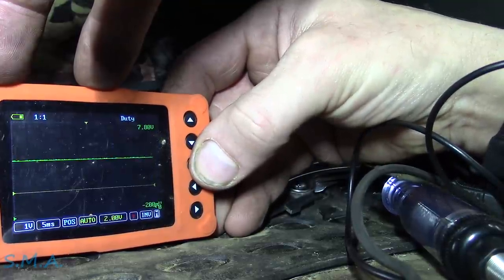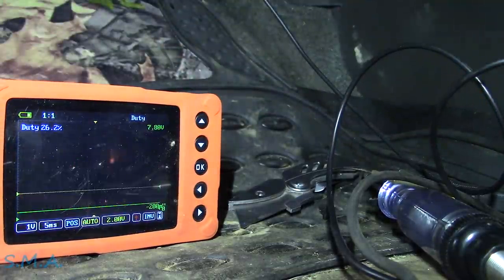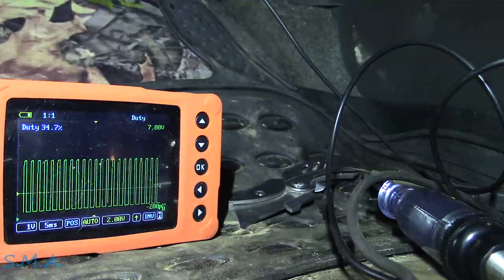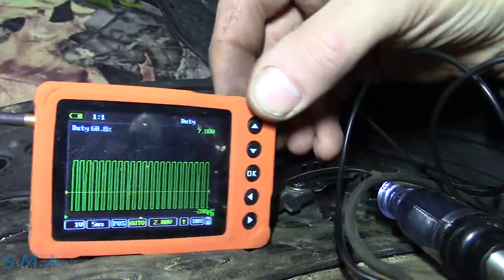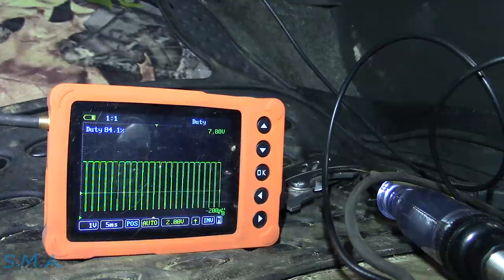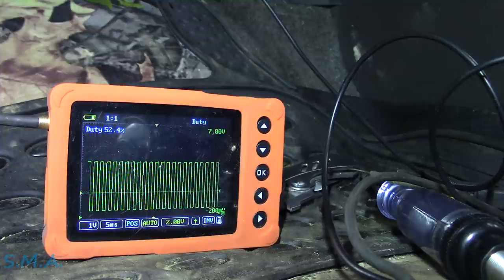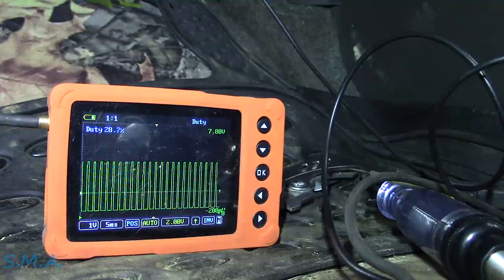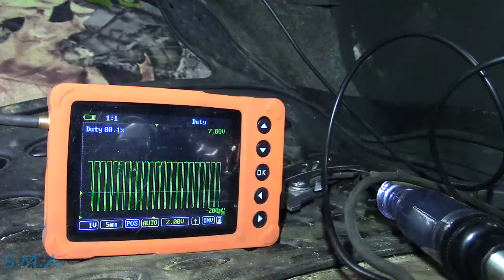We'll select duty cycle. Our blower's on high right now, so let's kick her back a peg. That's off, that's low speed — next one up, next one up, next one up. You see our duty cycle over there in the upper left-hand corner? That's full beans. And then I'm going to bring her down progressively, one notch at a time. This thing's got a lot of clicks — it doesn't just have high, medium, low, so that's probably why it uses this style controller. As you progressively bring it up, the duty cycle gets higher. You can see it in the waveform until we hit full beans.